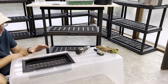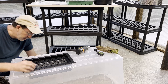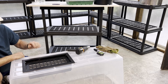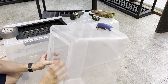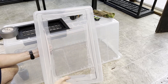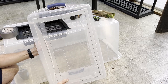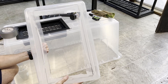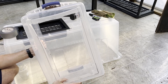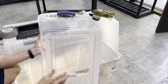That tape will seal it around here. The vent is going to automatically open and close depending on temperature inside of here — if you look below the louvers, that's where the coil is that opens and closes it. Now before I move on to the taping procedure, I want to show you what happened previously. You can see where I used the razor blade around this side, but I started cutting with my jigsaw and it's just too powerful and cuts through — this is brittle. Maybe if I'd used my heat gun before the jigsaw that would work, but it's really not hard to cut through if you just take your time, cut a little at a time, and use a hairdryer or a heat gun. Those come in handy for other things as well, like remodeling your bathroom. So remember: don't use your jigsaw — use a razor blade and a heat gun or a hairdryer.